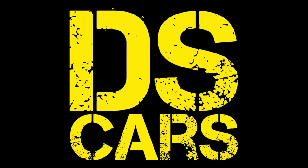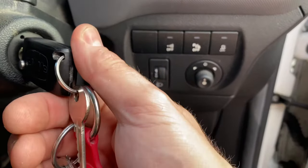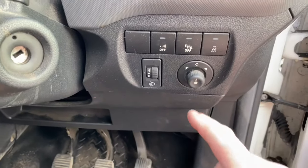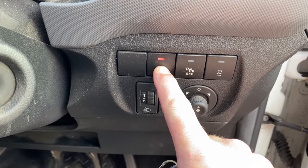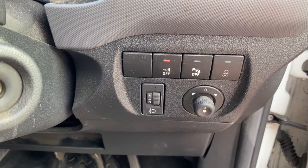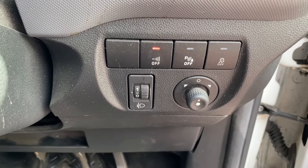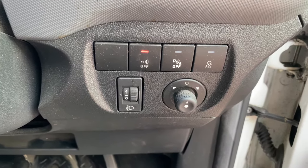Two to go — keep with me. If you want to leave a child or a pet in the van and still lock it without the alarm sounding: turn the ignition off, and within 10 seconds of doing that press this button and hold it down until you get a continuous red light. You can now shut the door, lock the door, and it will be locked from the outside but whatever's on the inside won't set the alarm off.